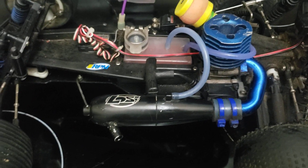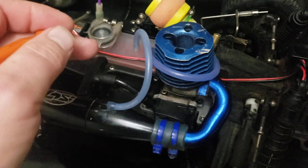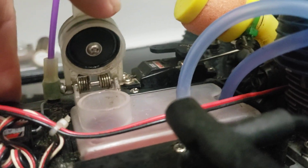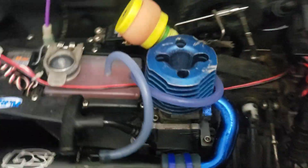Wuggie Nitro actually replaces tanks pretty often — he's got a great YouTube channel, cool dude. To him a tank is a service item, and a lot of people do that because your tanks get old. The seal, o-ring, or gasket goes bad and you get a pressure leak, not enough fuel pressure, and lean conditions and tuning problems all over the place.